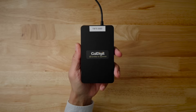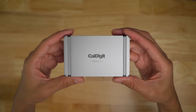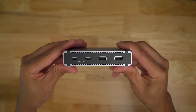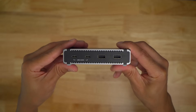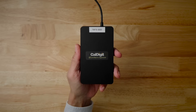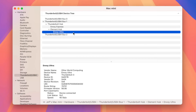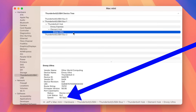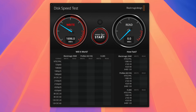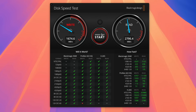Now connecting the OWC Envoy SSD to the Mac Mini via the original CalDigit Element Hub, which is Thunderbolt 4. This test illustrates why a Thunderbolt 5-enabled hub like the CalDigit Element 5 is beneficial. If you try to connect the Envoy Ultra to an older Thunderbolt hub, it's going to work, but its speed will be downgraded to 40Gbps, significantly limiting the true capability of such a drive. You can see evidence of this by noting the 40Gbps link speed in system information — and the performance when connected to the older Thunderbolt 4 CalDigit Element Hub is significantly hindered by the lack of bandwidth.